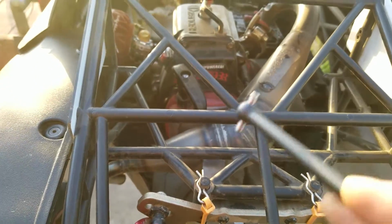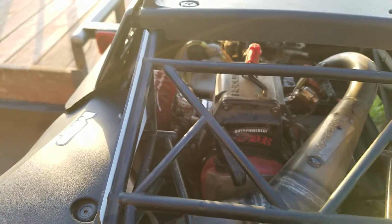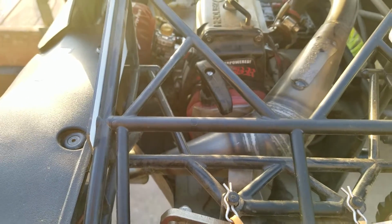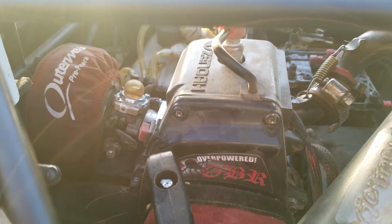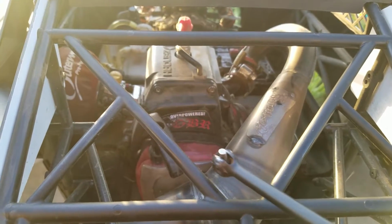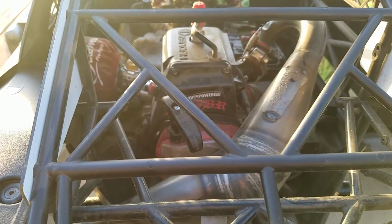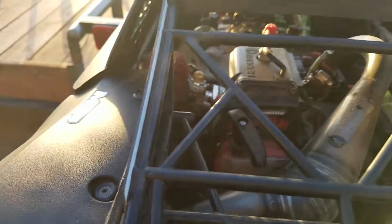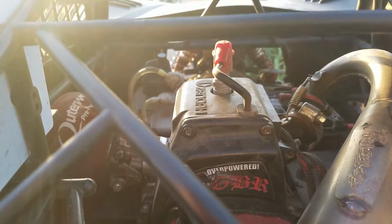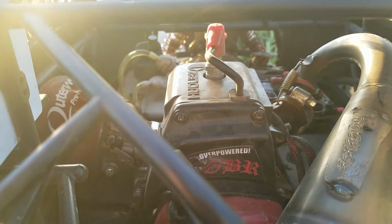So, had one experience last night. Had a little bit of a vapor lock in the fuel system, which was kind of bizarre. Couldn't prime it, couldn't start it. Eventually got it to where all the air bubbles worked out in the fuel system, and was able to get it started again. The thing I love about these OBRs, if you take care of them, maintenance them right, they literally start on the second pull. This one did. I primed it 10 times, just enough to make sure there's pressure in the fuel system. Gave it one slow pull, and on the second slow pull, it fired right up. I'm not kidding. It works that well. Make sure you have a good plug, though. The NGKs that you can buy from Dave's Motors are the ones that come with the OBR. Replace them with those.